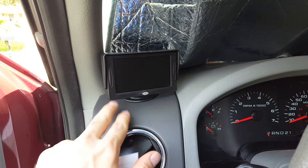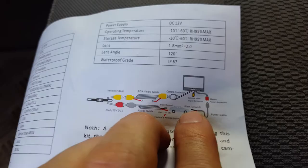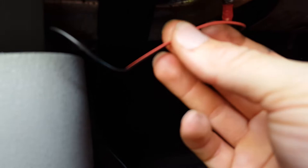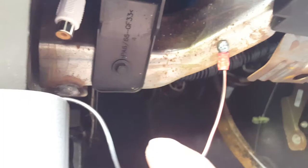What I did with the ground — the black coming out of here — is you get a better feed this way. If you don't do a good ground, I found you end up having distortion on your LCD. So I stripped enough wire back from that power feed that goes to the LCD monitor. The all-red is going to the all-red off of the video feed RCA cable. I came up underneath here and there's a metal plate — I used a self-tapping screw and put on a crimp-on terminal, and I was able to ground it right there.